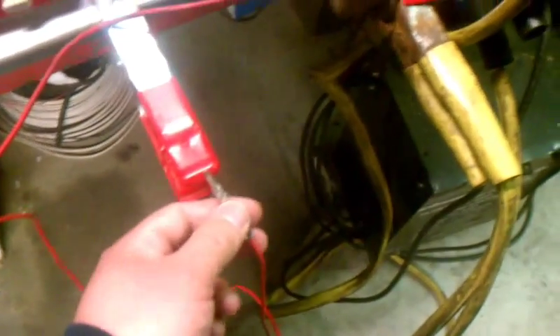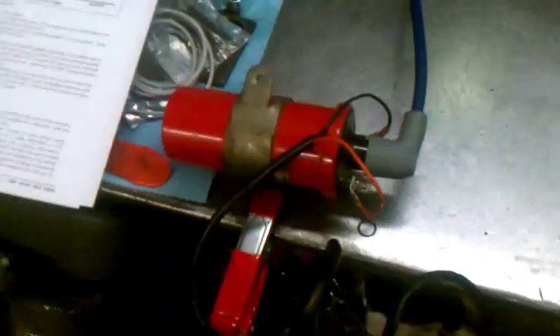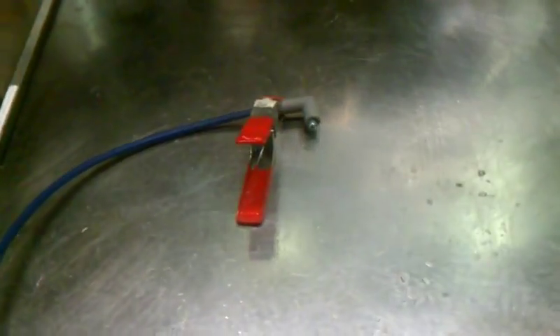My switch power is right here on a roach clip. Then you've got the coil over here — it's grounded too, though it doesn't really matter; that thing could be floating in space and I think it'd be fine. I've got the coil wire going over to an alligator clip about a half inch away from the grounded surface, which is what MSD recommends.